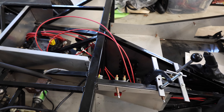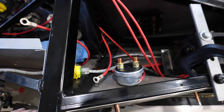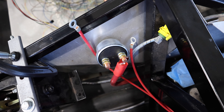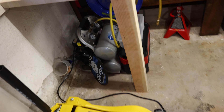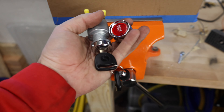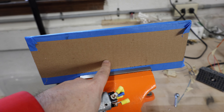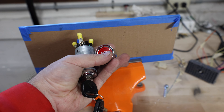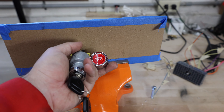Now I should be able to attach those positive wires. The battery cable is run so I can hook this up to the battery cable and see if everything's working. Of course I don't have the right size crimper to crimp a four gauge wire that needs to run from there to that bus, so I'm going to have to run out and grab that. But before doing that, I can put in the ignition switch as well as a push-to-start switch. This is going to be my temporary dash for right now, just until I figure out where I want to mount it. This way I can get everything wired up, make sure everything works correctly, and then cut the wires to length later. So let's go ahead and drill these in.